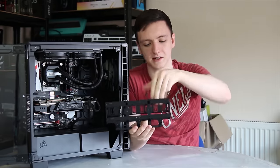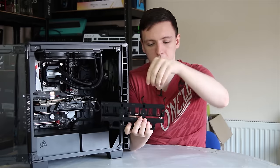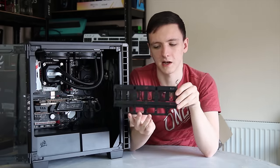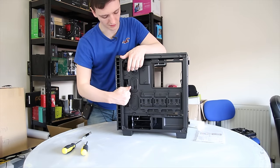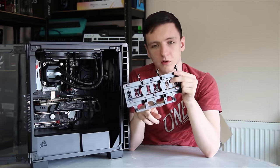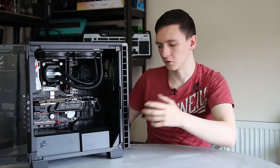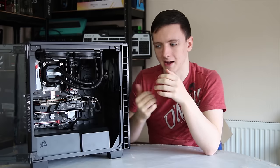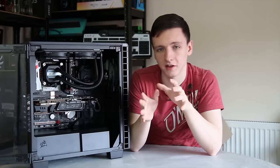The other thing on the back, in terms of storage, is this triple 2.5-inch or SSD bay. You drop the SSD in, there's a little spring at the bottom and it latches in with a clip at the top, and then you can put your SATA power and data connectors in from the top to connect it to the system. It's a very efficient and space-conscious way of storing up to three 2.5-inch drives out of the way, which is really nice. You can remove it with two thumb screws, and I personally chose to remove it since we're using an M.2 SSD — no 2.5-inch drives — so it just gives more room for cable management in the back.